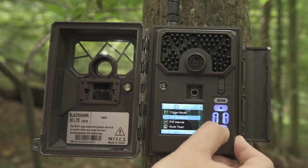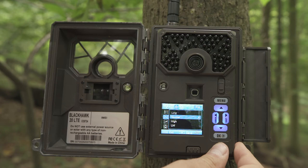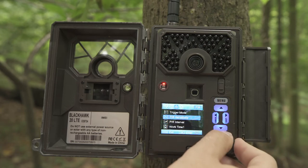In Time Lapse mode, the camera takes pictures at defined intervals: 3, 4, and 5 minutes in steps of one minute; 10 to 55 minutes in steps of five minutes; 1 to 8 hours in one-hour intervals; and 12, 16, 20, and 24 hours in four-hour intervals. To adjust PIR sensitivity, hit the down arrow to PIR Sensitivity and hit OK. You can choose between Low, Normal, High, or Off. We suggest Low for temperatures under 10 degrees, Normal for 10–80 degrees, and High for temperatures above 80 degrees Fahrenheit. Hit Menu to go back after saving.